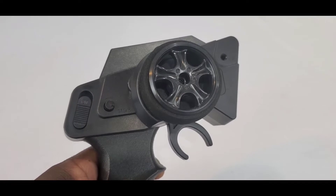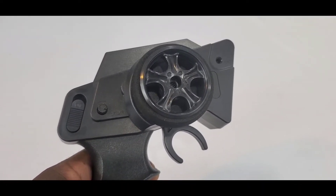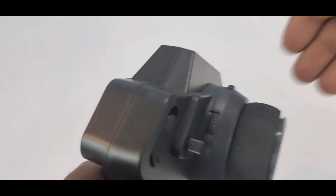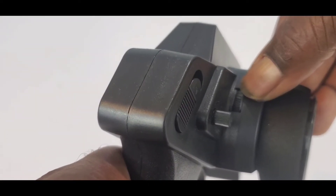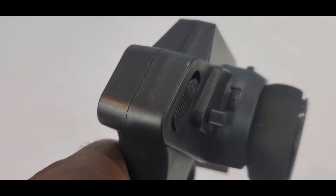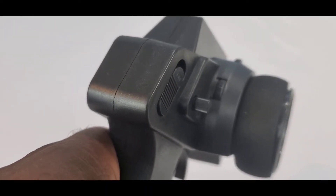First, whether you're running an analog or digital radio, I'd like you to put the throttle trim to neutral. On a Minidom, it's analog — it's the thumb dial right here. You want to match the lines up, center the lines up to the center indicator. On a digital radio, it'll be different; it'll be in the settings.